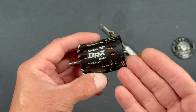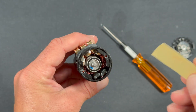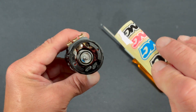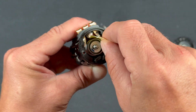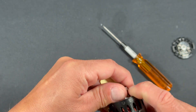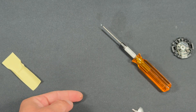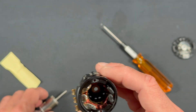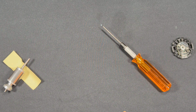If you ever overheat a motor, the part that weakens is actually the magnet, so you're going to replace the rotor. Since it wants to stick to one side or the other, getting a full wrapped tube of material down in there is not going to be very easy. But you can do it on the side that's away. I cut a piece of decal material and slide that guy into the little gap on the other side — get it down in there as far as you can. Then when you go to slide it out, you put a little pressure down towards that and slide it out on that instead of just dragging it along the side. Watch for shims — there's typically always going to be shims on the pinion gear shaft side, and there's going to be one probably stuck down in the bearing as well. I usually like to move it sideways so it slides off of the bearing race and then it comes right out.